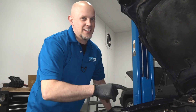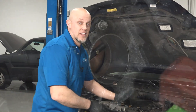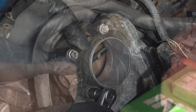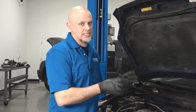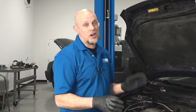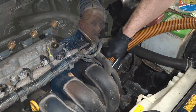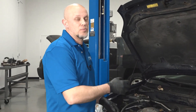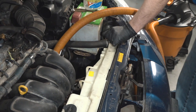But we're going to test this a little bit differently. We're going to take the snorkel off and the throttle body — the reason I take the throttle body off is because it's electronically controlled and I don't want to mess any of the electronics up. We're going to hook up a shop vac backwards so it's blowing or compressing air into the intake, and we're going to spray it down with soapy water. Wherever we find bubbles, that's where it's leaking from. Let's turn it on and see what happens.